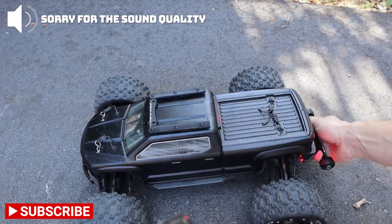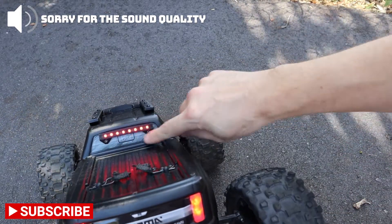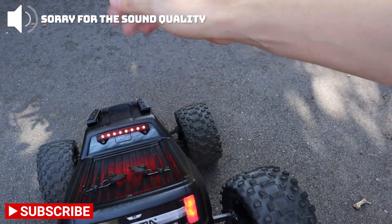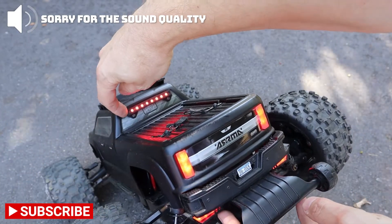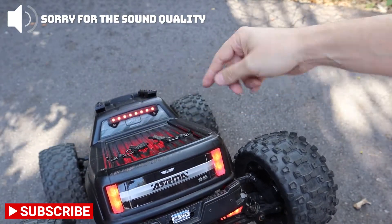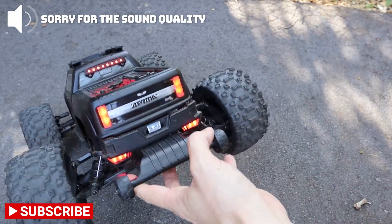Same for this one. The stoplight is pretty easy too — same as the roof. You just have to drill two holes here, and actually a third one for the cable that goes here. That's pretty much the same as the roof: put the two screws here, bolts on the inside, and you're good to go.